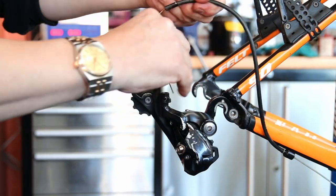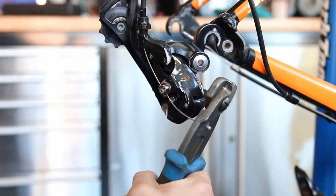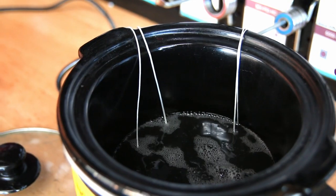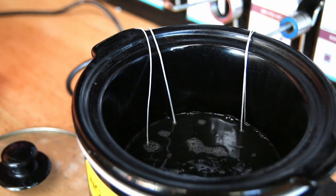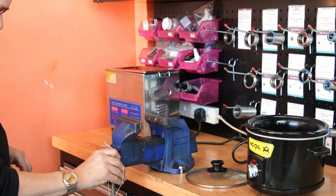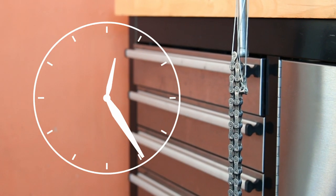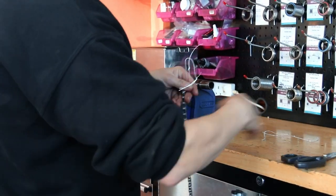The cost is relative to what you're achieving with your riding — it's pretty cheap really and pretty easy to get done. You just book your priority slot online with us. If you're in our area in Suffolk in the UK, you should be well sorted. You can see here those bubbles in the wax — those bubbles are all the air and any water left over inside the rollers of the chain coming out, and then the chain fills with wax. We just leave it to harden off, then we break down that wax and you've got a lovely, nicely lubricated and clean chain.